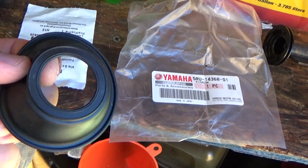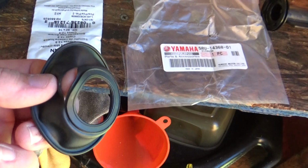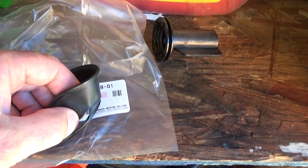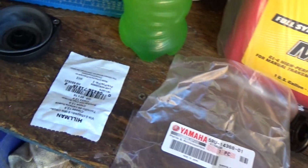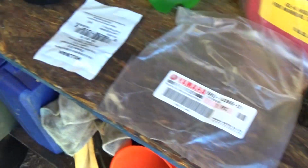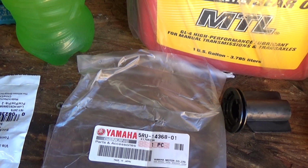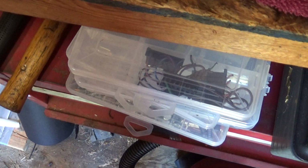What this eventually caused, and it wasn't an instantaneous thing, it actually took a few days, and then all of a sudden, after getting gas on the way home, it would barely hold 55 miles an hour. And then after I stopped at the stop sign, it wouldn't go above 4,000 RPM. I was lucky to get to about 45 miles an hour top speed. Not good. But after looking around on Majesty.com, that I've been a member on for over 2.5 years since buying this scooter, it's a well-documented issue.